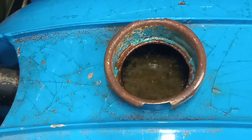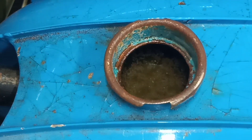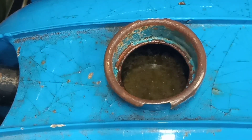The process is called chelation. What's happening is the iron molecules in the rust — the iron oxide — are having their bonds broken and being drawn into suspension. The little movements and odd bubbles you can see are hydrogen, because hydrogen is produced during this reaction. So you don't want to put the lid on, and keep it in a reasonably well ventilated area, just like when you're charging a battery. You can see it's starting to go a little bit yellow — that's the reaction working. We're going to leave it overnight and come back tomorrow to clean it out.